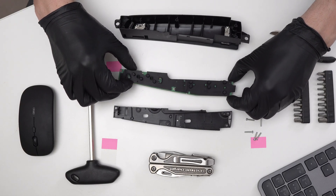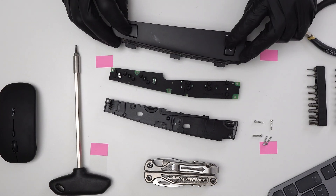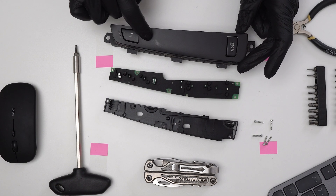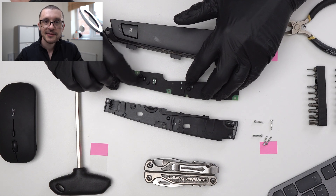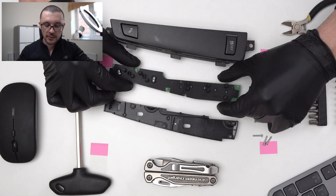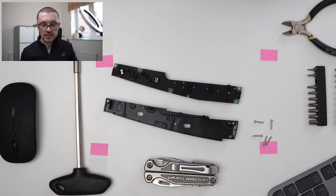Take a look at this and tell me what you see. In the standard form, we had only two switches. I've done the retrofit to the switch that also has the mode select on this one. However, you need to be mindful that there are vehicles that have more accessories and they will have switches for rear view camera and other accessories. My conclusion is that BMW has manufactured and placed all the possible combinations of switches on this PCB board. They've done the rubber mask and the switching element to fit all of those. And the only difference when it comes to actually producing different parts for the vehicles will be this exterior mask that will feature some of the switches or not.